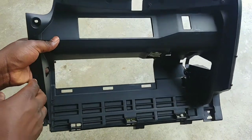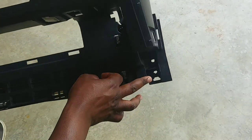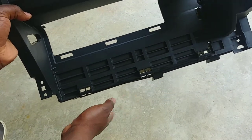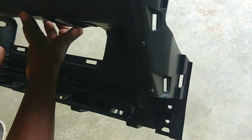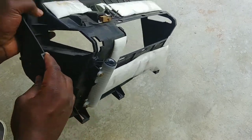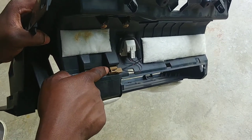Removal is not too hard — it's basically eight screws that take this out: one, two, three, four, five, six, seven, eight. Once you remove those, you have the bottom tray with your puddle lamp — pull that down, it releases from here. Then basically just pull this out. There's a side thing as well, then this one is just locating it. Then disconnect — in this case, just one connector.